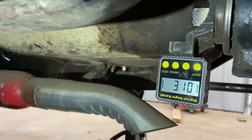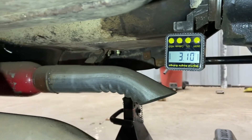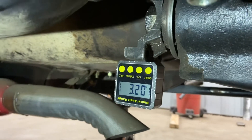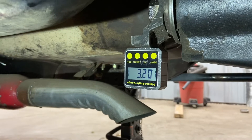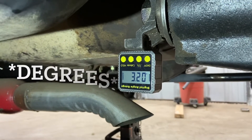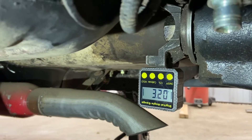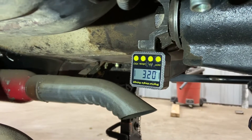So now when you accelerate the car, it'll tip up this way and it'll level out to where your pinion angle becomes straight — and that's where you avoid those vibrations. That's one way of finding your pinion angle. You just take the angle from the front, whether it be down or up, and then you do an up or down pinion angle on your rear. You try to set it where there's a difference between like 1 and 2 degrees. If you launch hard it could go up to 2 degrees, so I'd like to go somewhere in the middle, about 1 to 1.5. That should be a good angle for your pinion.